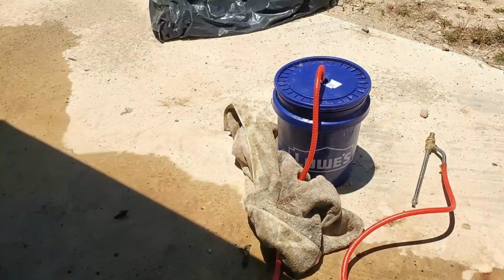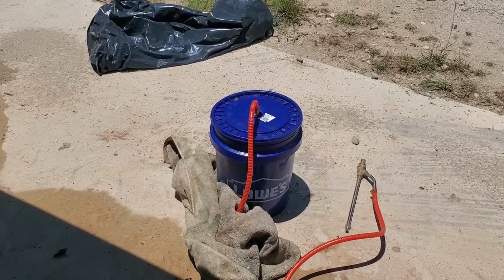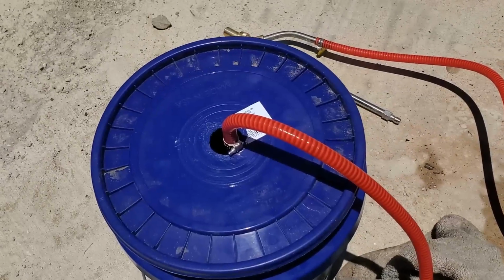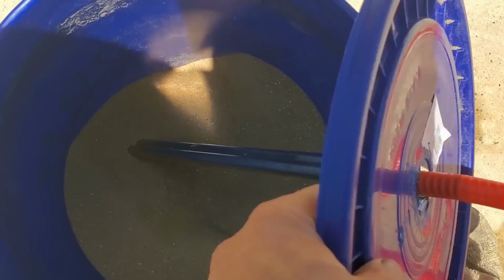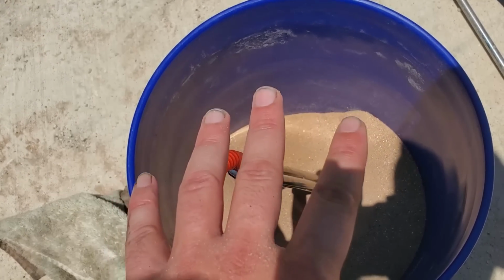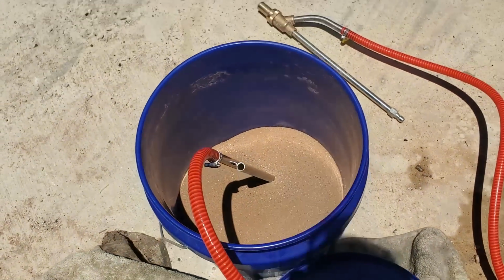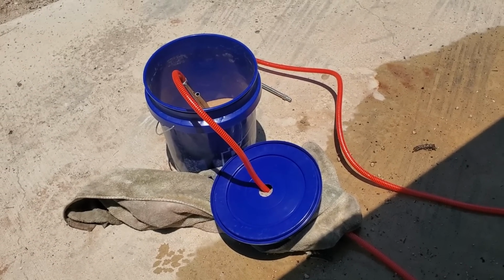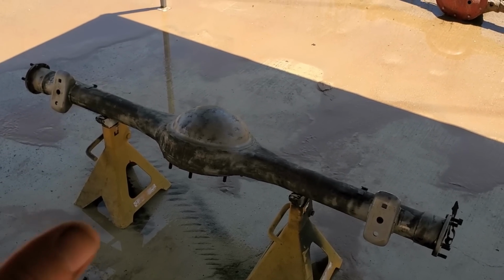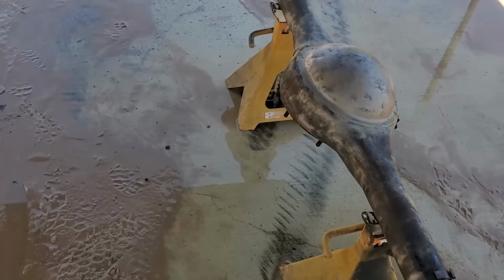Here's the downside. Is that bucket. Now, I just did this method because I had saw some other people online do this. I would highly recommend if you can make a hopper bucket, that would be the way to go. Even though they give you this self-feeding line that you plop into the sand, if y'all noticed, y'all couldn't see the bucket, but every time I came over here, I had the lid on. But I was grabbing this hose and doing this a few times and shaking that sand. I bet you if you put this thing on a hopper setup, it would work 10 times better. Because once that sand hits that nozzle, it just starts rocking and rolling. If you noticed, it pulsed quite a bit. And every time it pulsed, the metal turned gray. And that's where it did its best work. So for 30 bucks, I'd say it's pretty good.